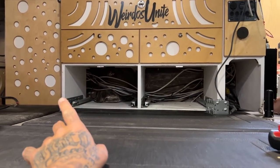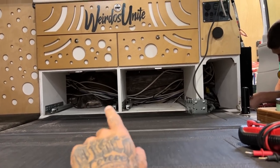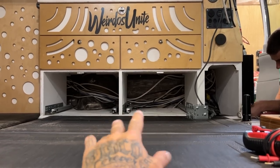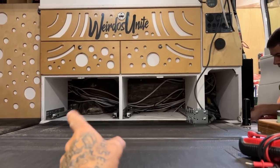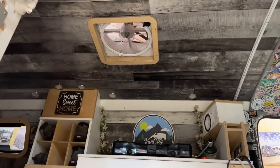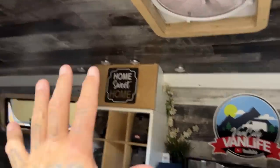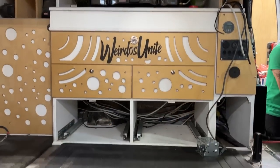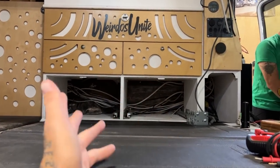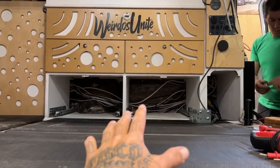From where all my electrical is in the front, you'll notice that right along the bottom side of all my drawers behind the cabinet there's a section where all the electrical is. Every cable that runs to the back is run through there, keeping it accessible so you can fix things super easily - pop out two drawers and you have access to pull out a cable or fix something. We did the same thing for running all my puck lights along the roof - everything is done behind little kick boards. Pop out a few screws, that comes down exposing all the wires. I have nothing buried behind my walls anywhere, making things easy to repair or add to if needed. Always think about having accessibility to all your electrical when building a van.